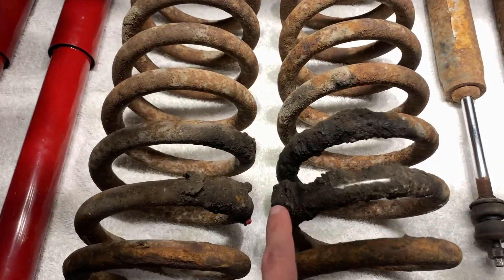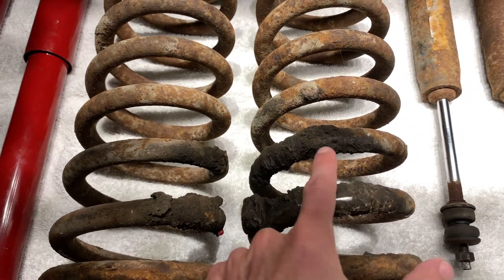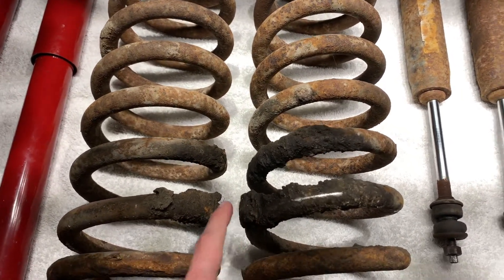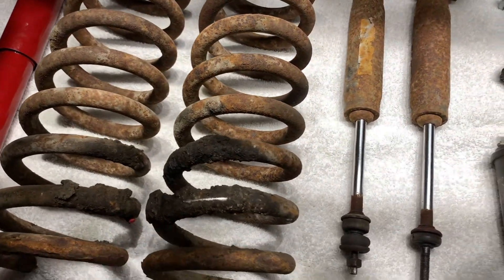You can see a large amount of deposit build-up here. After some investigation around the engine it appears there's a small gasket leak on the passenger side just underneath the valve cover, so that's going to be another thing that will have to be sorted out — you can see all of the residue build-up over the years.